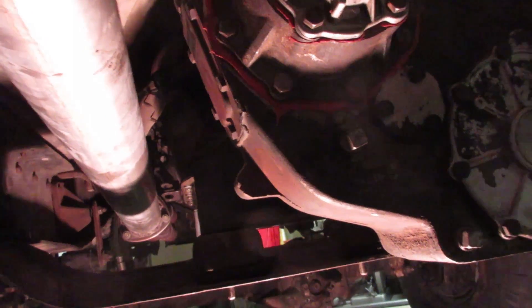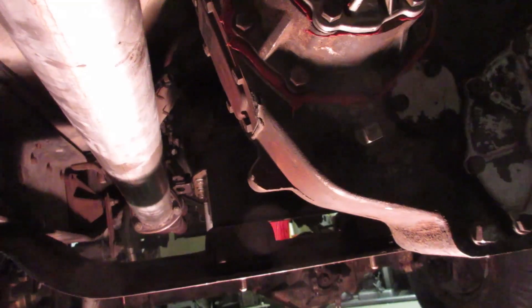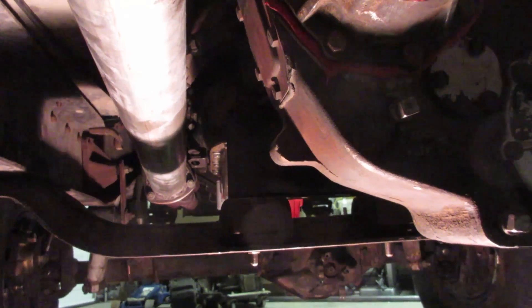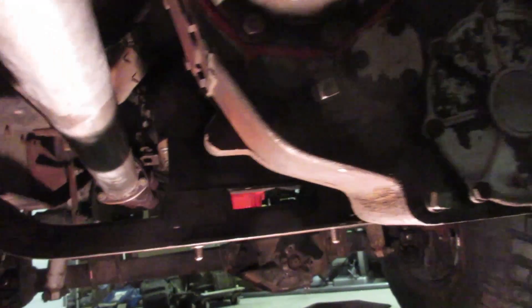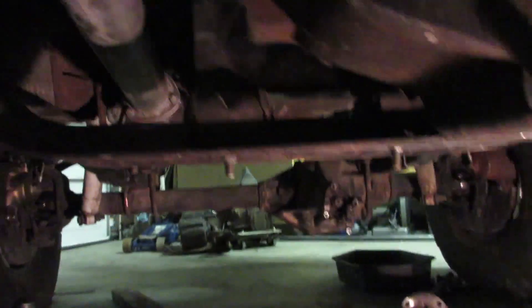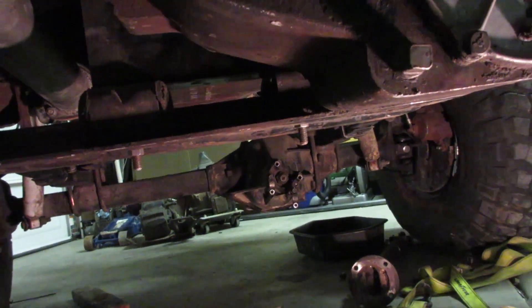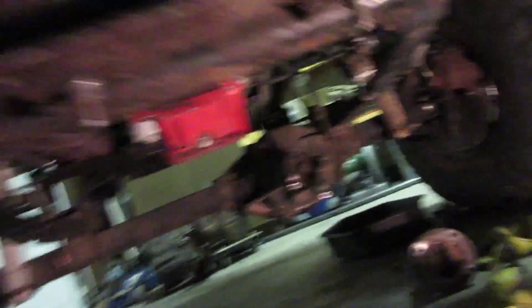Let me get you under here and show you what is going on. I was going to stop pretty much after I had dropped the other one, but I ain't playing around. So I went and took the flex plate off of the K20 and the sleeve, then I popped it up in here, torqued down the ARP bolts, and then I had to slide it on the ground to get it underneath, and then I had to use my jack to get it up onto the trans jack.